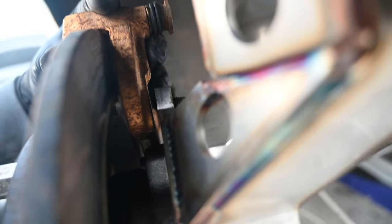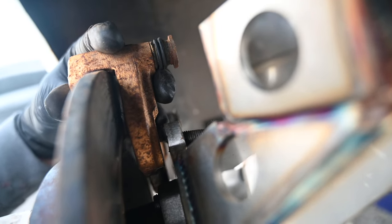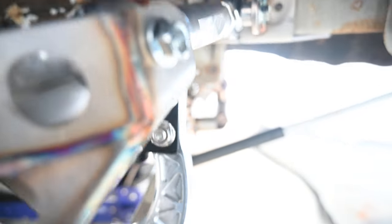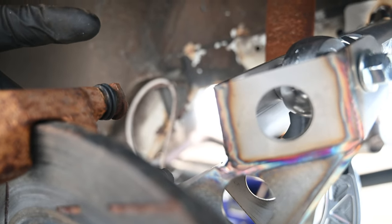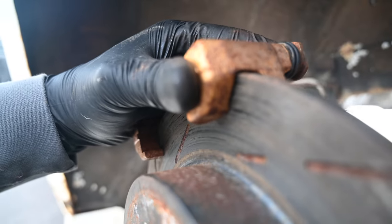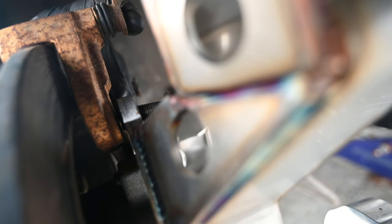There's nothing included in the kit as a spacer, nor is there any hardware for one. This is supposed to be a bolt-on kit — that's how they portrayed it — and so far it hasn't really been bolt-on, because it didn't come with the bolts either. Had to order those from McMaster. And now the caliper isn't bolting up. I'll review their videos a few times because they just look like they threw on the stock calipers. That's a good amount of space on the backside, and the caliper bracket is as far over on the rotor as it can be.